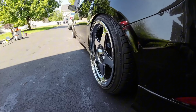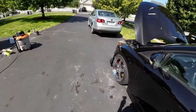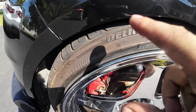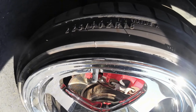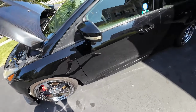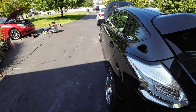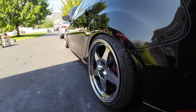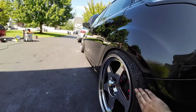I'm kind of experimenting with tires before I spend a ton of money on them. So right now, I don't even know what these tires are. I got some of these. Don't even know what they are, but they're this. And my specs on my tire, I could put up in the description too. 225 40 ZR18. So that's what I'm running as of right now. It is a thicker tire. So if I like these, I'll probably go with some R888s, some Michelin Sport Pilots. I don't know. We'll see how I like the fitment.